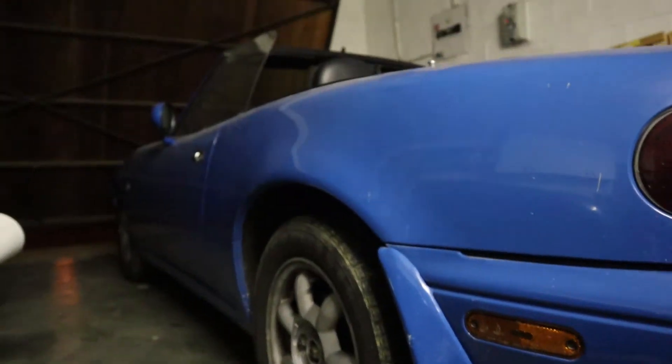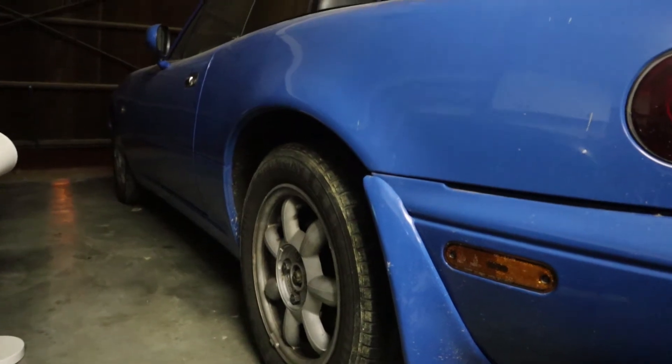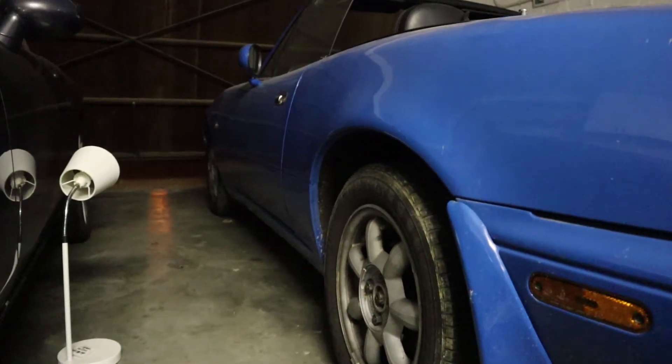There is still some possibility of the springs sagging a little, so ride the car for about a week or two and then adjust your final ride height. Since I wasn't sure what ride height to go for, we're still a little high, but we can ride these in and see if we need to go lower. The front and rear are pretty much at the same height. I matched the distance between the upper preload stop and the lower ride height locking nut at all four corners.